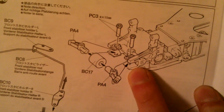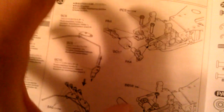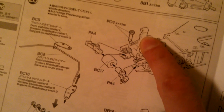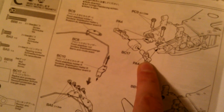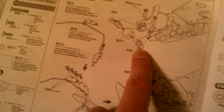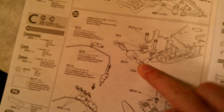One thing I remember reading about in this chassis is how the front suspension is designed to absorb front impacts. Basically there are hinge pins that a rocker arm rotates on, a rubber cushion that the rocker arms mount into, and a link for the front suspension arm. If the wheel gets pushed back, the rocker arm rocks backwards and dampens that motion — that's how the front suspension can move to absorb impact in a crash. Pretty neat design.